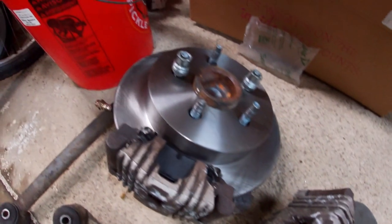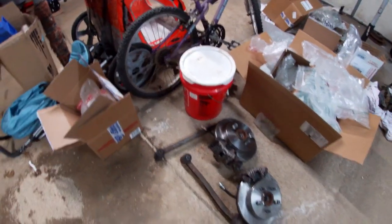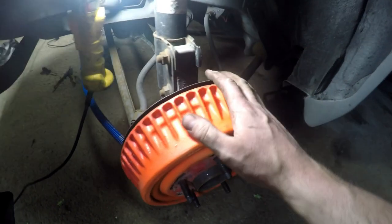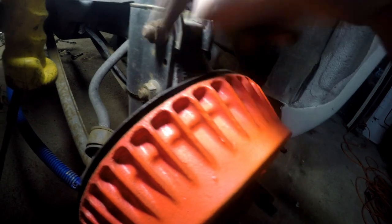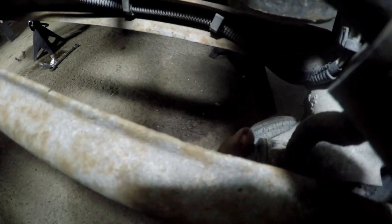Look at these beautiful assemblies — ready to go. We'll swap out the trailing arms when we put them in the car. To get this assembly off with the wheel removed, here's what we're going to do: two 18-millimeters — punch these two bolts out. You have a 15-millimeter on the bottom of your sway bar down here.